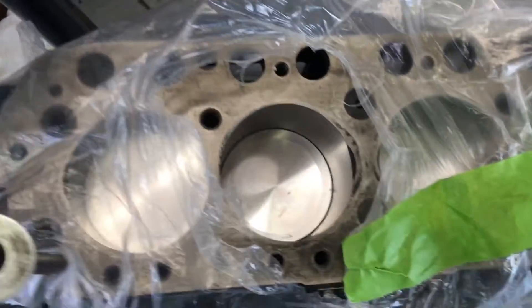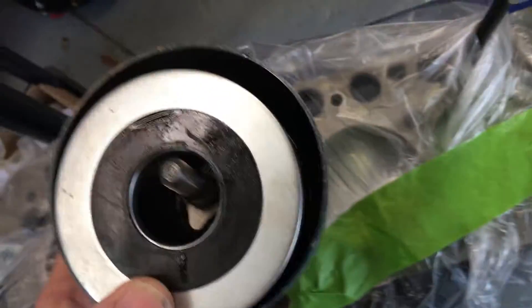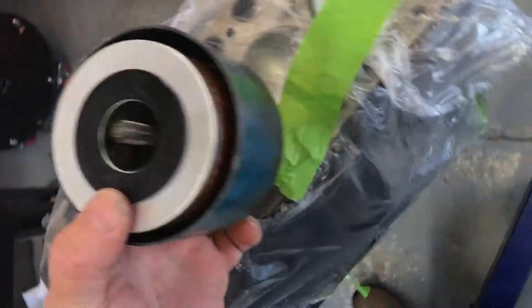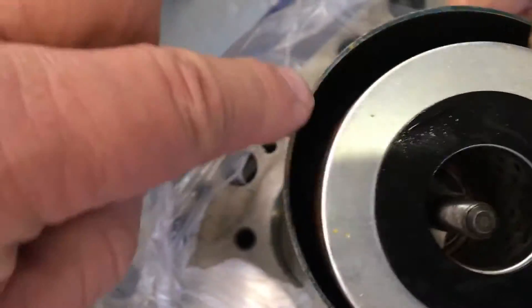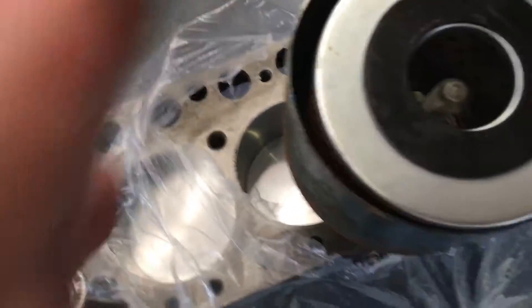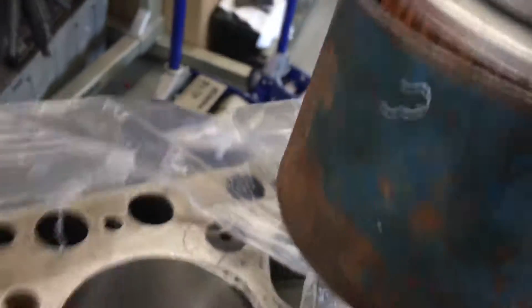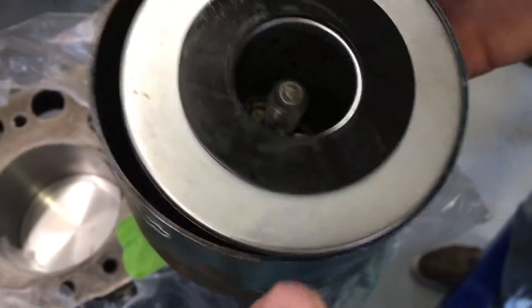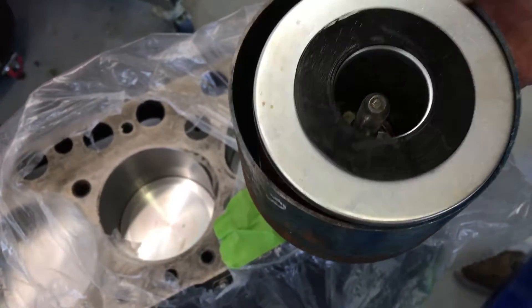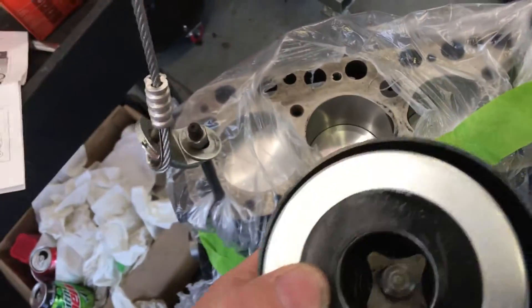Let's get back to the 76 TR6. It's got a canister and I'm going to show you the actual real canister. Now, this canister has this little lip right here, and that little lip sits in a groove, and you've got to get it just right. Anybody that's changed the oil knows that if you don't get this just right — it has spring pressure. If you look, you can see the filter actually sticks up past it. So you've got to hold it and hold it right, and then tighten it up. And if you do it wrong, you'll fire the car up and you'll see a puddle of oil directly underneath the left front side. You want to check when you have these canisters — they're really, really hard to fit and do just right.